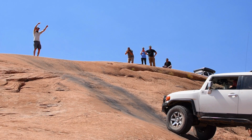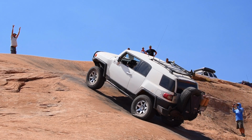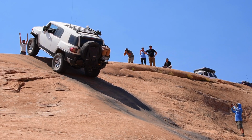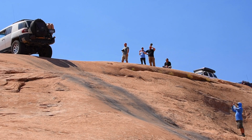I would have gone with more to match, but I went with an aluminum bumper, so it wasn't needed as badly. Because of the dual batteries and the winch, though, I did jump up from the standard 600-ish coils that they bring in, and went ahead with the full 700. No sway bar, right? No sway bar.